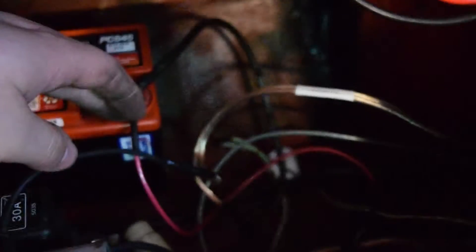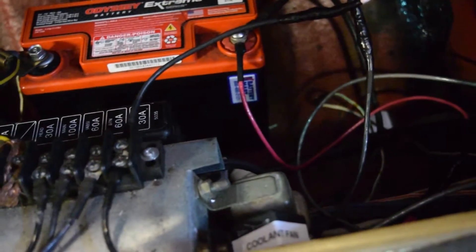I'll throw up the wiring diagram — it's very similar to how I did the fuel pump relay. I've got the power to the fan coming out of the relay, with two of the relay pins going to constant 12-volt positive battery power. The ground is switched: one wire goes to the grounding block, and another goes into the relay. When the switch is on, the ground is connected and the relay is on. When it's off, the ground is disconnected, the relay is off, and the fan is off.